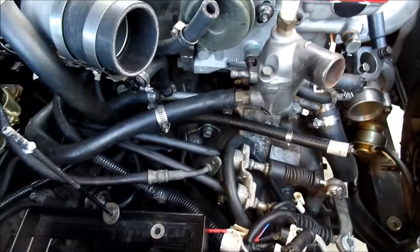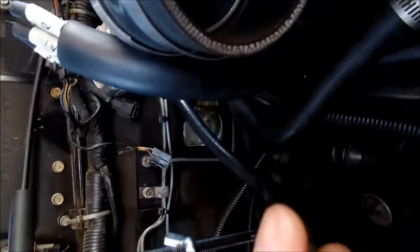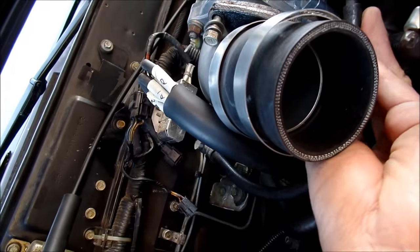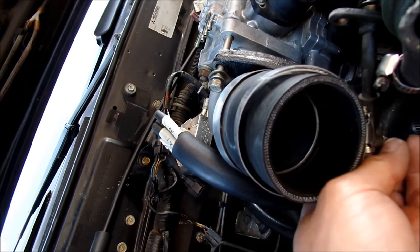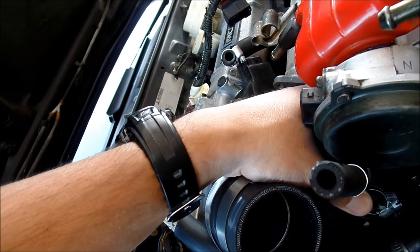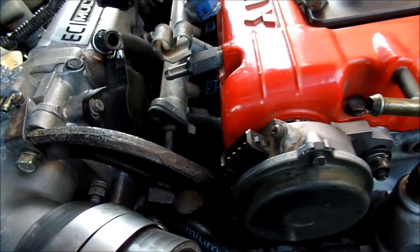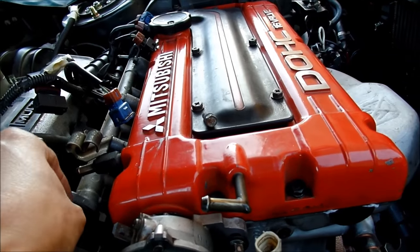Go ahead and stick some on that O-ring and spread it around with your finger. You could also put some fuel on it if you have fuel handy — I'm just going to use silicone. Hopefully this won't affect the injectors — it's just a very light coat. The fuel will kind of dry it out. There's an engine hook bracket in the way — that's annoying. Let me fix this first. There we go — just kind of slipped in, no problem. The bolts go back in.